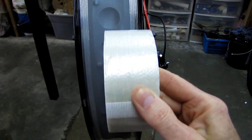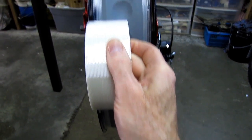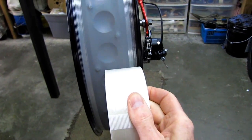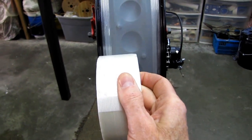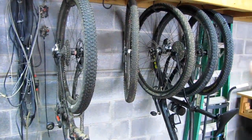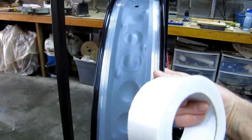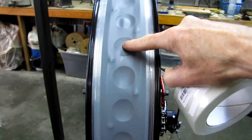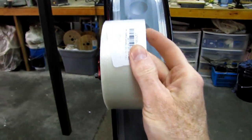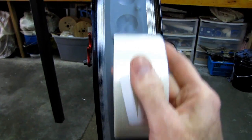After the half-inch wide tape goes down, I've got this two-inch wide strapping tape and it will offer support in the middle. I'll go over to the very edge and cover up the half-inch tape, then come over to this edge, and probably do one down the middle after that. So there'll be two wraps and then a third wrap right down the middle. This rim strip is pretty thick but it's bulged in from having the inner tube in it, so this will give it more support.